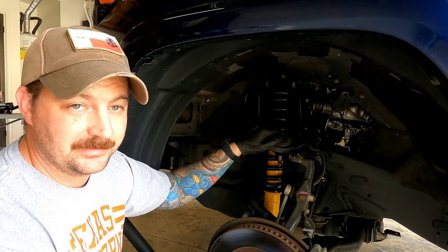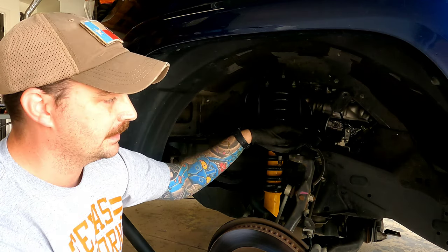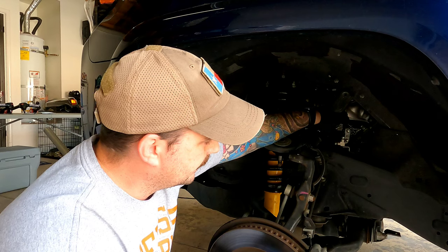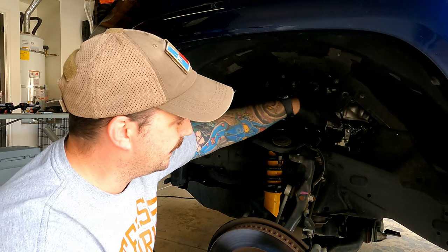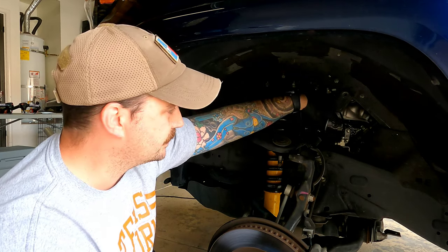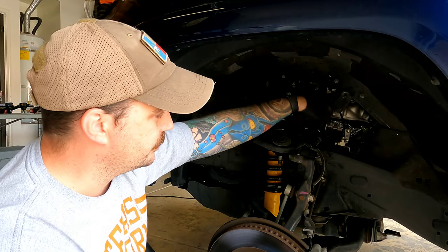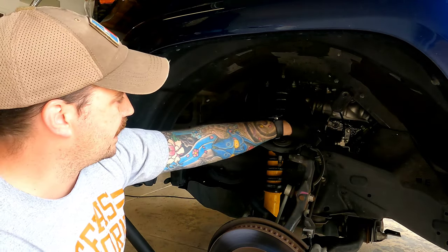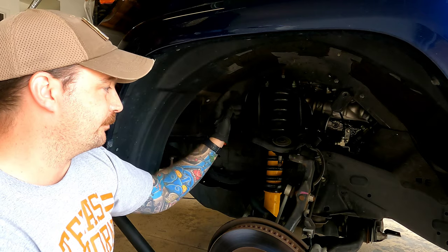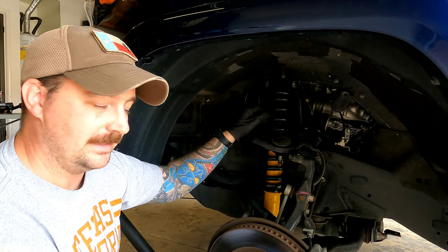After working through it, we went ahead and loosened the nut for the bolt that goes all the way through the upper control arm. One helpful tip: use a 12mm to remove the bolt that holds the brake line bracket to the frame, just to loosen it up and give yourself a little more room to get a wrench or socket in there — otherwise the hard line blocks access. We'll remove the nut and then slide the bolt out, with an extra set of hands to help feed it through.